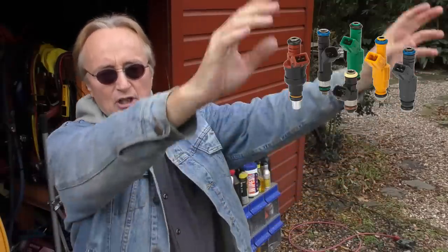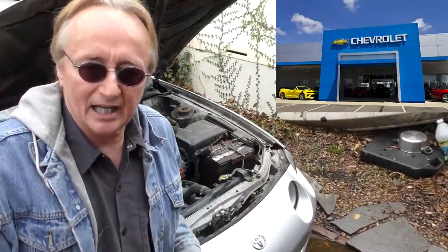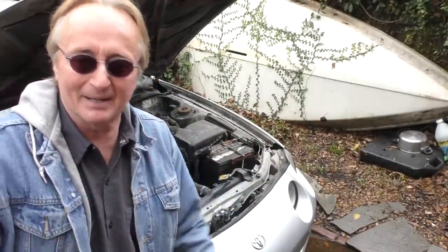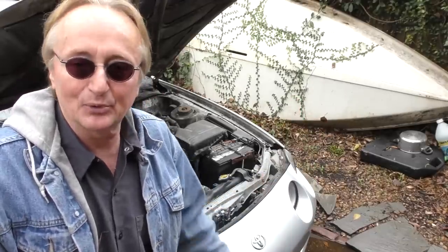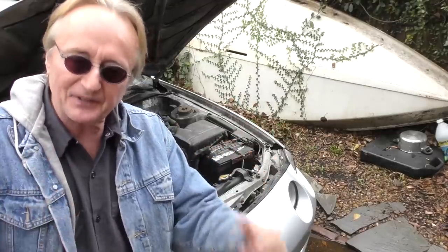That's the advantage of buying a good car like a Toyota — rarely do the injectors break. And if you've got a four-cylinder, it's only got four injectors, so just replace them all in one fell swoop. If you don't want to buy expensive brand-new injectors, buy a set of calibrated rebuilt injectors — make sure they've been recalibrated. There are places that rebuild them and do a decent job. Or if you have a really old car, you can go to a junkyard and buy four of them off the same engine — they'd all be pretty much the same. You could try used ones if you're in a gambling mood, just get them off the same engine.